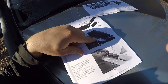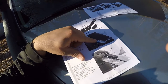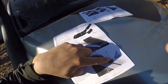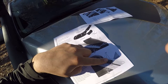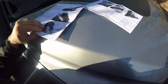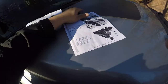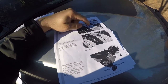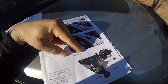You line up and mark your bracket up here on the A-pillar. I opened the door and used a marker to mark it, then center-punched and drilled three small holes into the pillar. It doesn't affect the airbag at all because there's a metal part inside that separates the interior from the outside — you're just drilling into the hollow inside of the A-pillar. Then there are little rubber expanders and self-tapping screws that go in there.